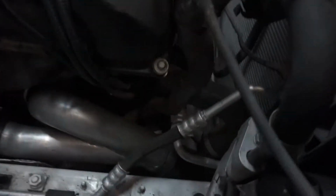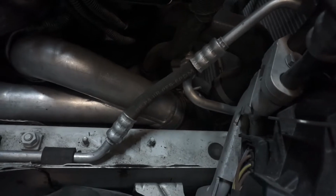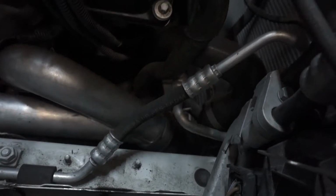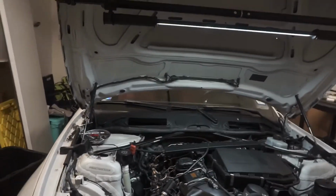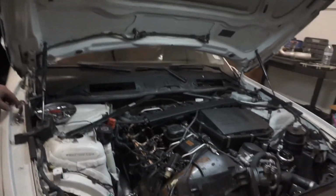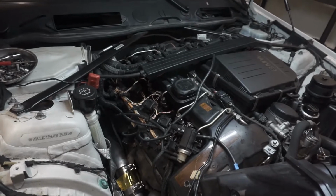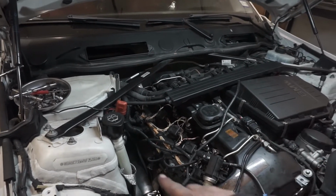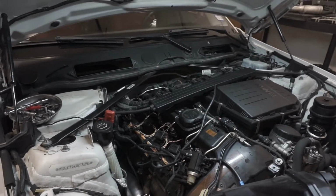So essentially, the coupler coming off the outlet, going into the radiator, Jesus, intercooler. We did have to reposition that coupler as well, which was tons of fun. Good deal. So what we're going to do now is we're going to start getting our lines reran, boost solenoids reconnected, get the heat shield reran inside of here, and then do a startup.